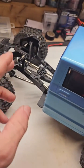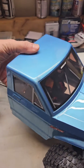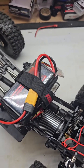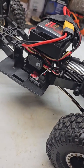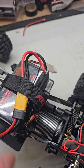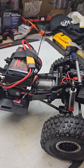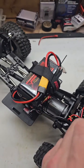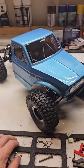And there we have it. No battery in the back — battery is in the cab, and it is the 4200mAh 3S pack. It's in there nice and securely. The mount works as I intended it to. This is only for trail running and more run time, not for performance at all. I can run the smaller packs for better performance, but this will give me more run time, which is what I was after. Thanks for watching.